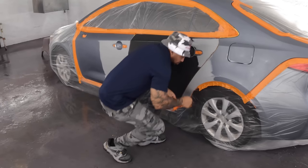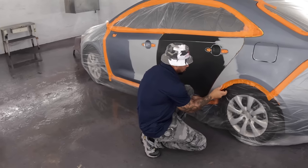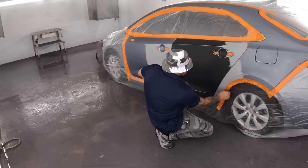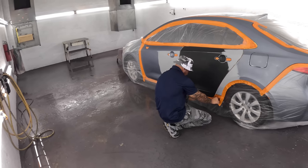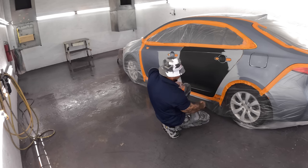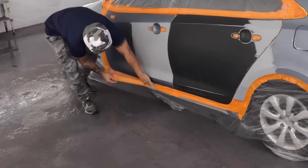Then you come in and you want to wet everything down. Be careful not to wet up electrical connections, outlets, anything you got going on there, your plugs — keep all that stuff away from the water. I know a lot of this sounds like common sense, but you'd be surprised. Somebody gets trigger happy with the water hose spraying down the air compressor, all electrical connections — next thing you're going to spray and you got sparks, everything arcing. It sounds like common sense, but it's really not so common.